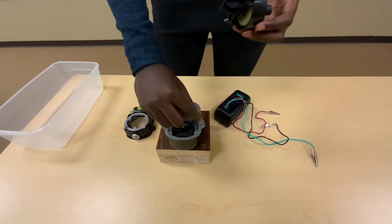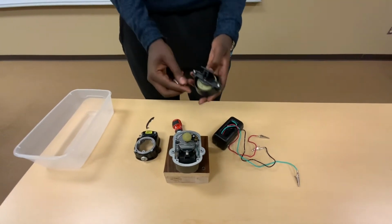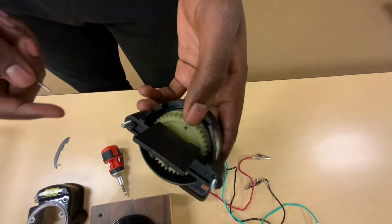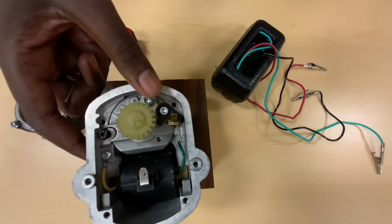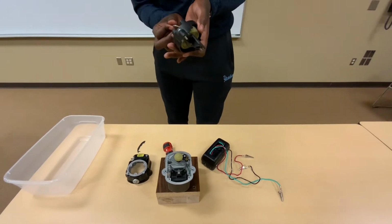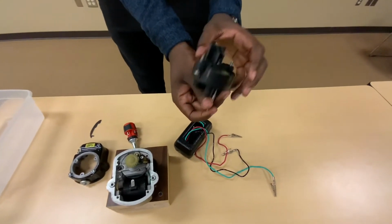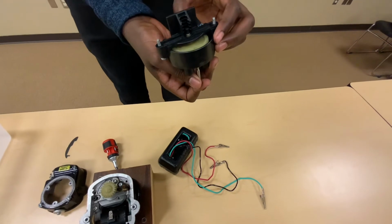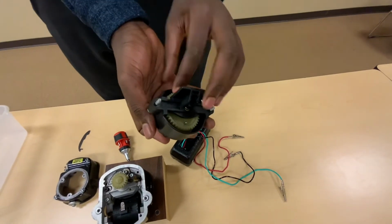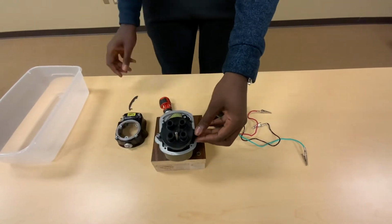So we'll start by putting this back, making sure we're putting it the right way. Before you put the distributor block assembly on, we have to make sure that we put the timing pin right on the L mark, because as Mason mentioned earlier, this is a left rotational magneto. So we take the timing pin and put it through the left rotational hole, which is right here, just for reference, and then we put it at the L mark hole, which is on the other side through the gears, and that's when we put back this distributor block assembly.